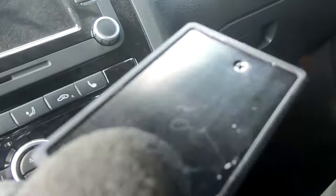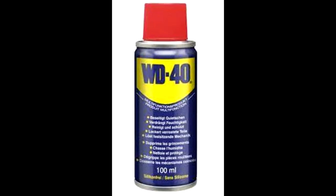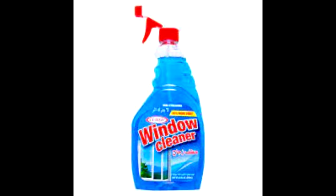So the dash cam is off, but you still have the adhesive stuck to your windshield. That's why I'd recommend using any sort of sticker remover that you can get at your local auto body shop or hardware store — even WD-40 will do. Then use your scraper or razor blades and gently start peeling it off. After that, wipe it down with some windshield cleaner to remove any sticky residue and you're done.